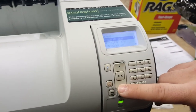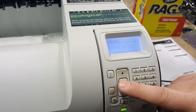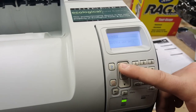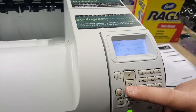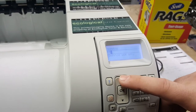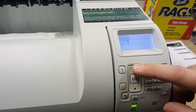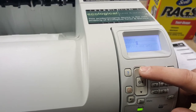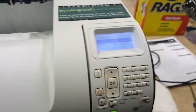What you'll need to do is just get into your menus and scroll down to the service menu. When you click on the service menu, it's going to come to the place where you need to put your service PIN or code in. I'm not going to read the code out loud — it'll be in the description below. You can just enter that code in, using the buttons up and down to scroll to your numbers and hit OK. Once you enter the last one, it'll automatically shift you into the service menu.